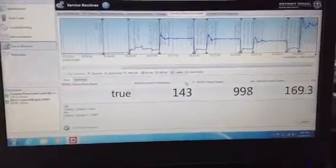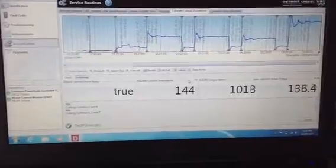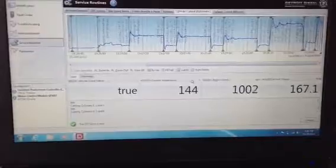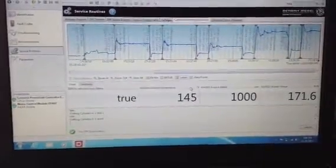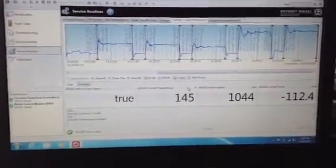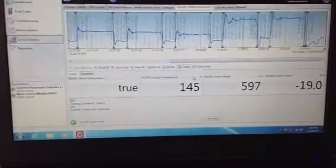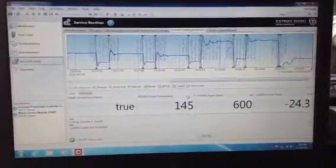This is the best way to find out if your cylinders are firing in the correct order and if the nozzle opening pressure is shooting diesel as it's supposed to. The cylinder cutout test is now completed. If an injector is not firing right, it will tell you right away which injector is not firing. Here everything passed, so everything is okay with this truck. Thank you for watching this video.